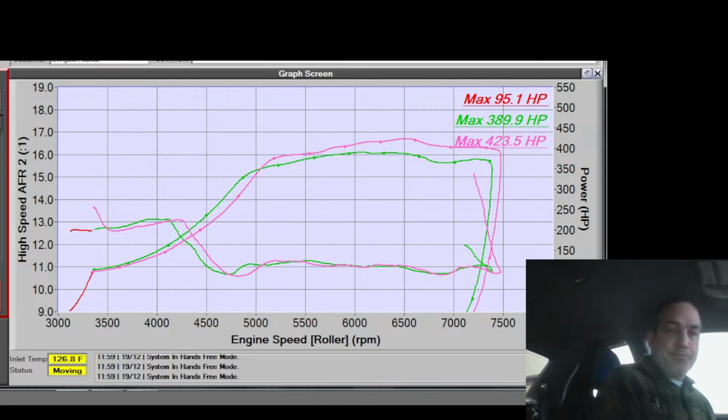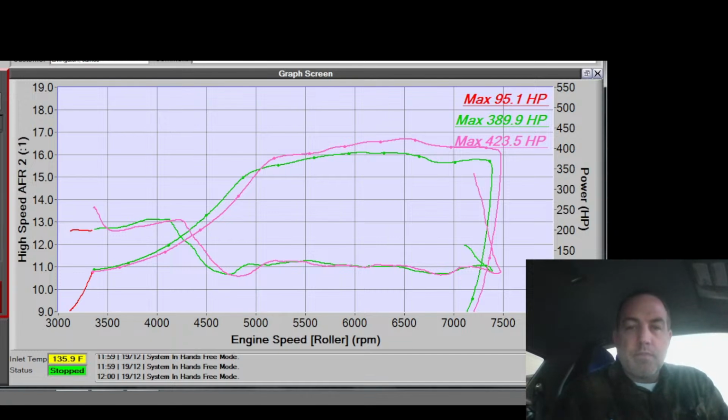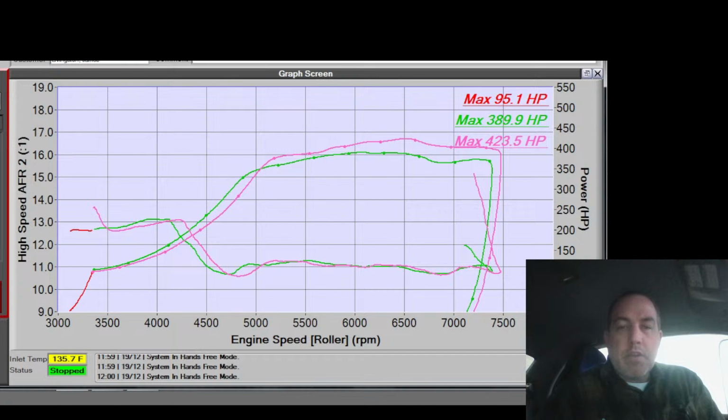Well, I definitely wanted timing, but it still looks like the boost curve. All right, and timing goes to cam timing. 68.7. So this has got aftermarket cams. Aftermarket cams are weird. Sometimes they want to be zeroed out like factory ones really soon, and sometimes they don't. And this one seems to be dipping really hard where it zeroes out. So maybe I need to add 5 degrees to the intake cam and see how that responds up top.